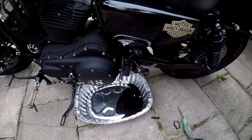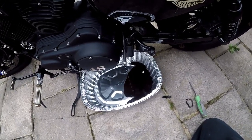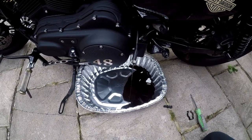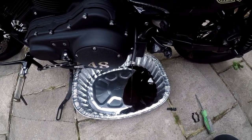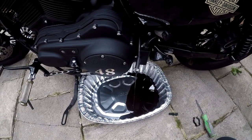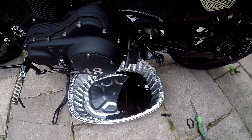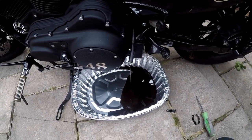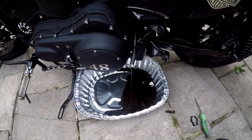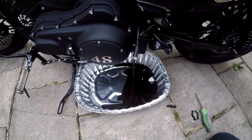What I do for a living — where I work, every time we service a machine, we take oil samples and send them away. You'd be surprised at what they find when they put the oil samples through their special machines. They'll come up with water ingress, aluminiums, irons — all various types of wear and tear that goes on inside your engine, most of it detrimental. But it gives us an indication if anything's going seriously wrong with the insides of your engine, which is quite handy. But for these bikes, there's no need to worry.